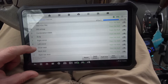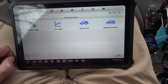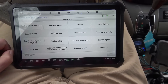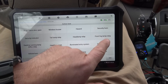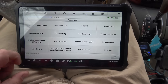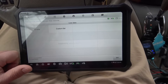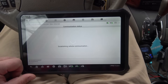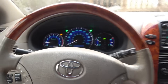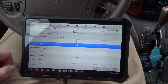Let's go with body — let's see what we can find in the body system. I tried to get into subsystems where regular scan tools won't go. Let's see what kind of active tests we have here. Trunk and back door open, wireless buzzer, hazard security horn. We can manually test the relay for the fog lamp, the headlight, the tail lamp, security, high beams. There's a lot of stuff here. I can activate the horn — I better not do that. We'll do the hazards — that's not going to wake anybody up. Hazard is currently off. I press that button there and I turn that on using the scan tool, then turn it back off. My friends, that is what's called bi-directional control. And that is beautiful.